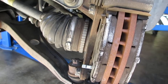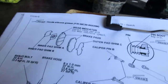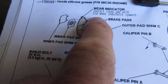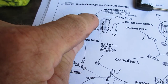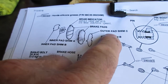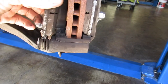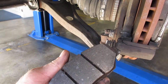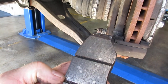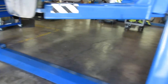The first thing I notice right away — looking at the factory manual from Honda — the inboard pad has what's called a wear indicator at the top of the rotor. The manual says to install the inner pad with its wear indicator upward. On this vehicle, the inboard brake pad's wear indicator is on the bottom. It's in the wrong place. You can also see different kinds of material in there — something shiny — I'm not sure what that is. So it's not installed properly.